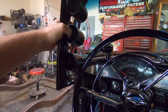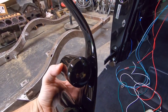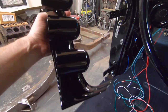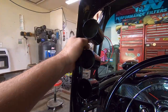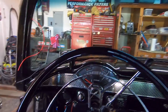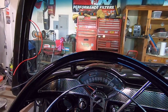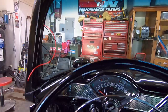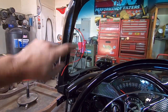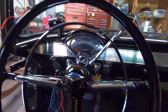I went with all three AutoMeters — oil, water, and volts. I made a triple gauge pod using the original A-pillar trim that will go up here. I used muffler pipe, pipe caps on the back, and pieces of round tubing for the wires to pass through to step them off. That triple gauge set will go into that pod. I really like gauge pods from my G-body days because your gauges are right there instead of looking down under the dash. I drilled holes in the A-pillar and have rubber grommets for the wiring to come out.